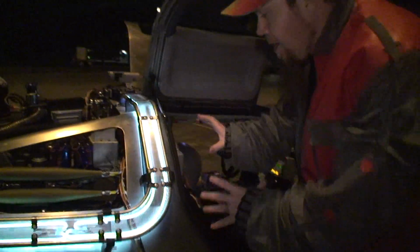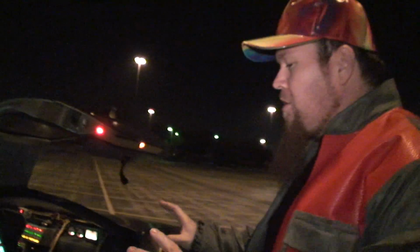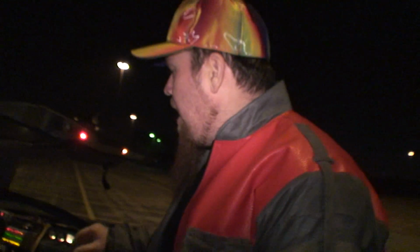How cool is that? Just like the original car, real neon tubing. No one has ever attempted this since 1985 when they shot the film. This is real 10mm white phosphorescent cold cathode tubing. This has all been custom made for this car, and even though it runs on a 12,000 volt transformer, it really doesn't use that much power the way we have it wired up.